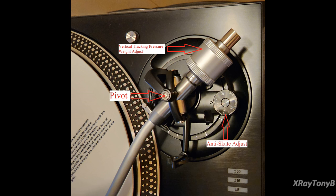In addition, you have the anti-skate adjust. When you turn that little dial, it applies a little bit of spring pressure to pull the arm back towards the outside of the record. The reason is that when the record is rotating, there's a kind of centrifugal force that wants to pull the stylus in towards the center of the record. As shown in a previous video on the Rotel turntable, you'll see how anti-skate really seriously affects the distortion and the channel separation, and how that stylus tracks in the groove.